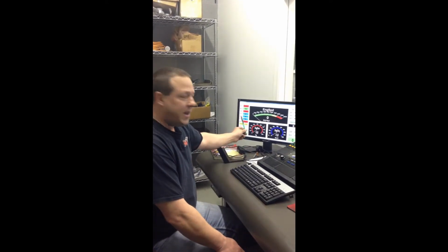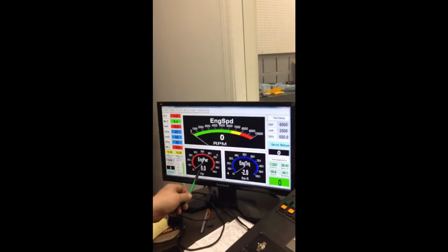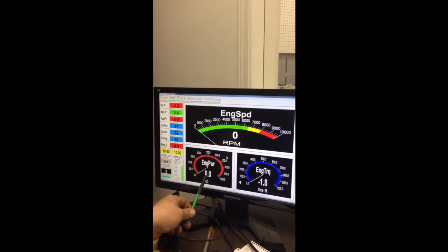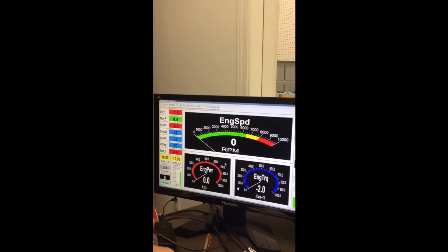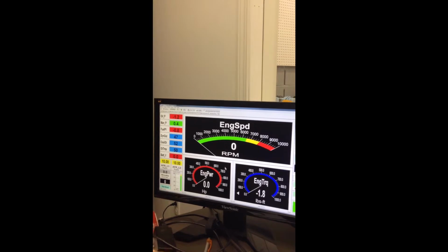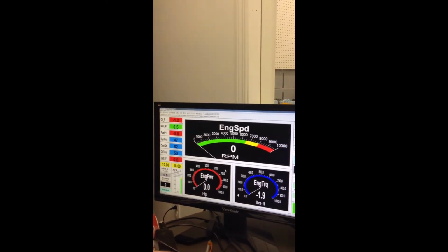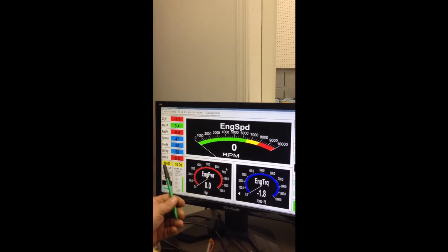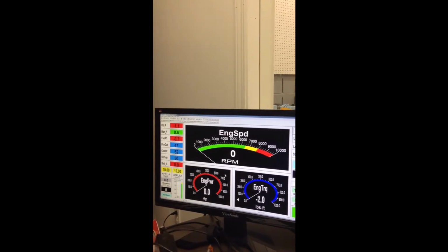A lot of times on YouTube, I've seen comments that you'll be looking at a sweep of an engine, and right here where it says engine horsepower or engine torque, it won't match what the dyno operator is claiming on YouTube. But this is just the actual horsepower and the actual torque of what the engine is producing at that time. That is uncorrected. So usually the corrected number is higher than the uncorrected number, and it's not that the engine builder or the dyno operator is lying to you guys. It's just that you're reading the uncorrected power and he is saying the corrected power.